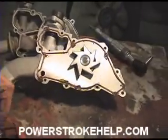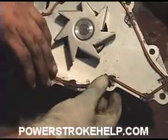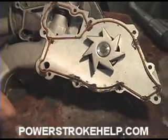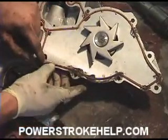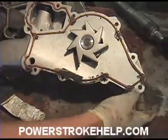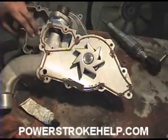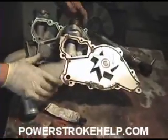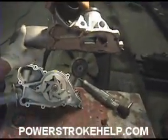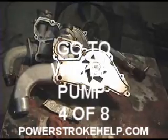I'm going to stick just another dab right up under here — that seems to be an area that wants to pop up. As you run your fingers around it, try to see where it's going to pop loose. I should have put a dab at these little corners instead of one in the middle. Just ease through it, see where it's popping loose a little bit. Look at it, take your time — you don't have to be in a hurry. Now the gasket will stay on there. It won't fall off now. You can set it on there without the seal coming loose.